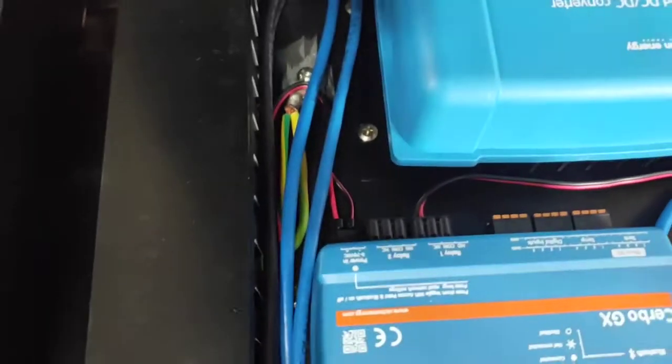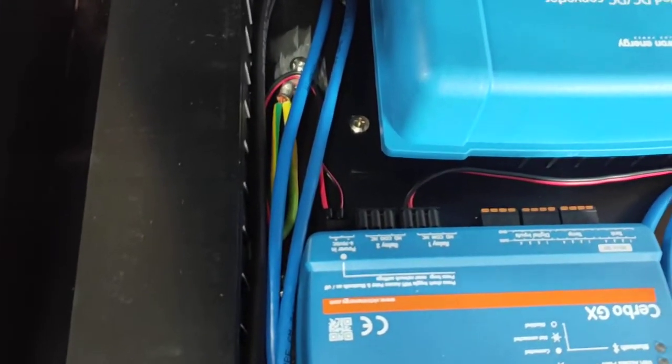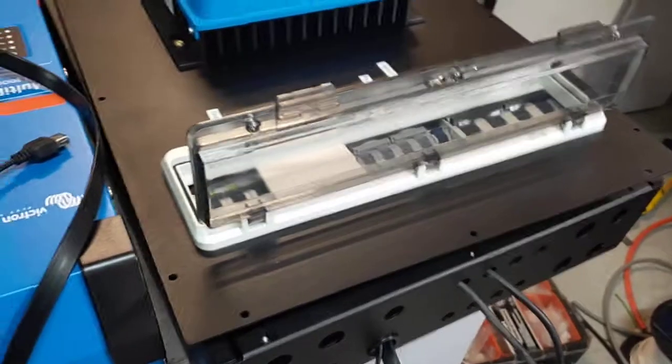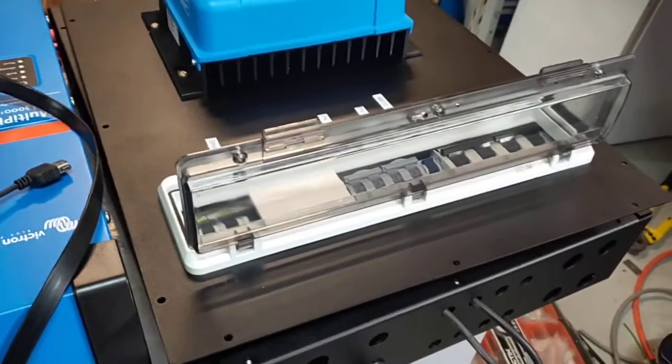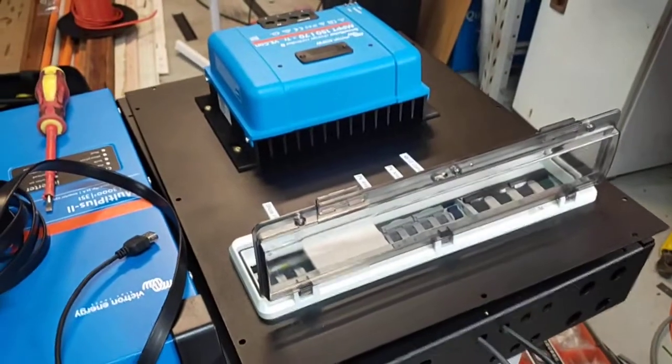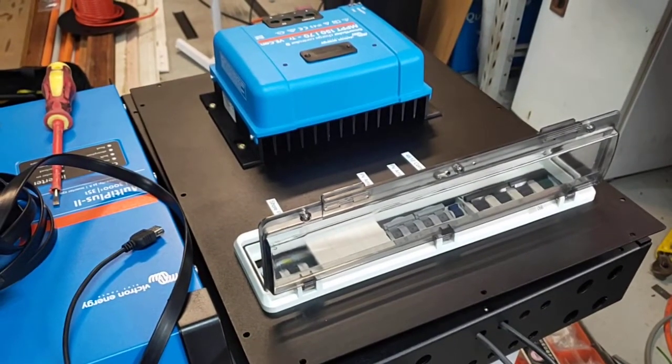Your sparky will need to connect a main earth wire from that terminal — it's a bit hard to see in there but in real life it's easy. Put a lug on a main earth cable, bring it out through one of these holes, and screw it to the bus chassis somewhere underneath one of the bins, just to earth the body of the bus. I'll do another video now with it starting up.